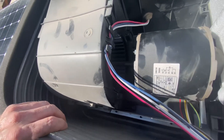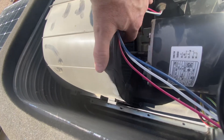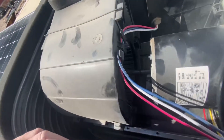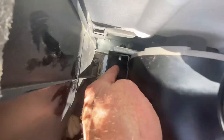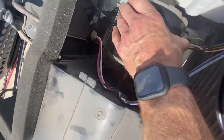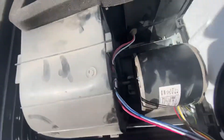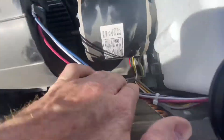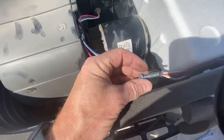It would just get stuck and just make a hum, sometimes it would just be screeching. I came up here and I could turn it just fine, so nothing was causing any problems with it turning. What I found out — there are these two screws, there's one here and there's one here, and this one had loosened so anytime this motor tried turning it was not in a good position.